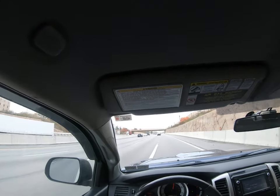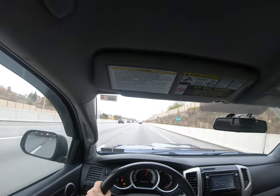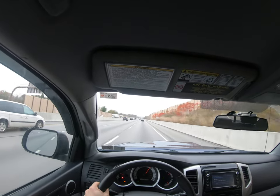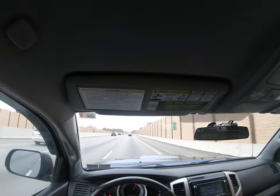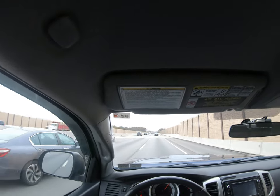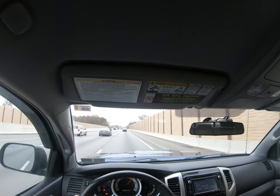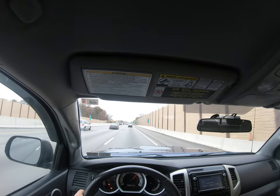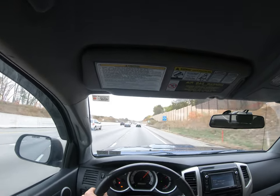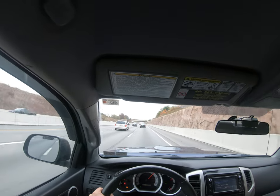This is what Toyota deems okay to sell to their customers, and it's no different in the newer generation — 2016 and up. Mine happens to be a 2015, and it's the same for the Tacoma and the 4Runner. Toyota says this is okay because they don't want to recall it. The real solution is a bushing — I can't remember the company name off the top of my head, I'll show you in a later video. They replaced that needle bearing with a bushing, which is way better with tighter tolerances than the stock Toyota needle bearing. If Toyota replaces it with another needle bearing, within 10,000 to 15,000 miles you're going to have the same shaking problem again.